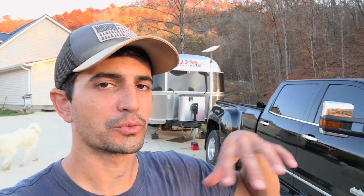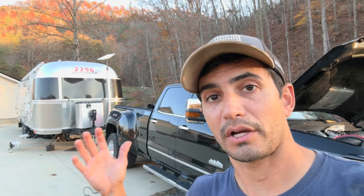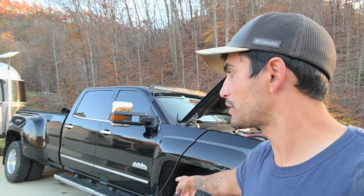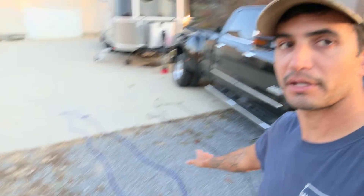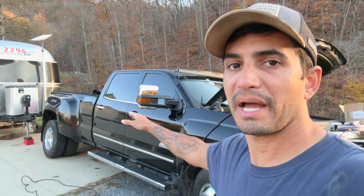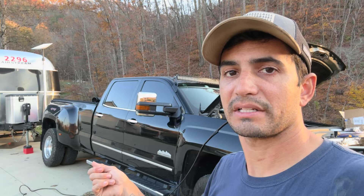There's a link in the description to where you can get all the stuff off Amazon. Depending on what size charger you need or what you plan on doing in the future will ultimately determine what size cabling you need. You can see I have a wire just hanging out of my truck right now, and some wire on the ground — this is all going to get run from the engine bay all the way to the back, where I'm going to mount an Anderson plug for where the trailer connects into the truck.